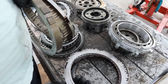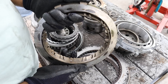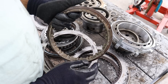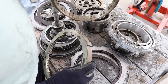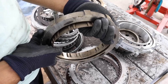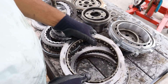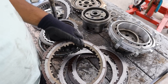So moving on, we had another set of clutches, and then we have this ratcheting gear which is like a one-way sprague type of gear, except it actually uses little teeth. Now when I was taking this thing apart, the little teeth that stuck out of here actually fell off. But essentially that would sit inside of here and it would transmit torque in one direction, but it would rattle its way in the other direction and freewheel — kind of like the cog on the rear of your bicycle. You can already imagine this thing going tick, tick, tick, tick as you're going down your local skateboard ramp with your Ford Escape.